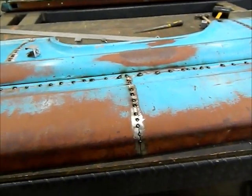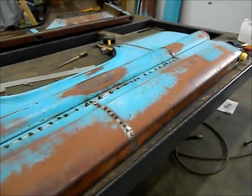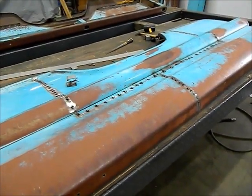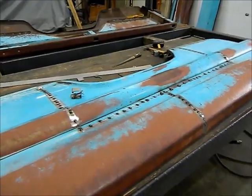I got the point lined up, went down, lined up the bottom edge, worked my way down, got this section all leveled out and tacked in, then flipped it over and did the inside. Now I have a whole lot of welding to do - it's going to be a slow process. I have to take my time so I don't put any warp in this panel. It's probably going to be two or three hours of welding and then some grinding. That's the steps it took to get this box shortened on one side. If you want a little more detail on assembly, leave me a comment and I can go into it more in depth. Thanks everyone.